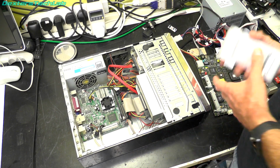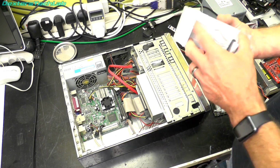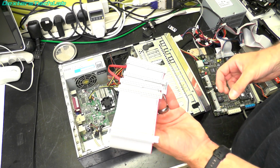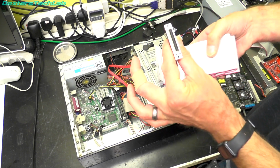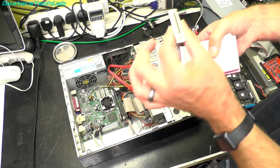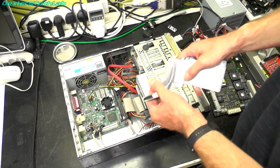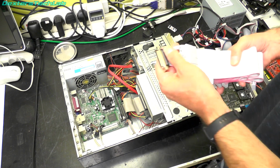I've been off and bought some more SCSI cables because yeah, I'm going to need some. And this particular one might actually be quite useful because it has a load of the 50-pin SCSI connectors on, and it has the micro D connector on as well, normally seen on SCSI 2 devices. But I wonder whether I might actually be able to mount that on the back plate as well and actually have more access to the SCSI outside the box. So that's another possibility.